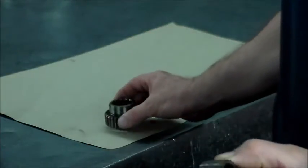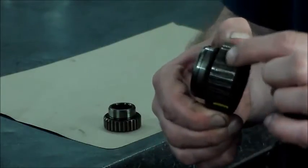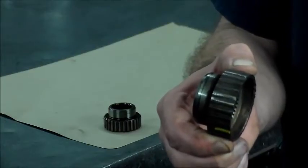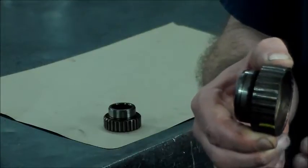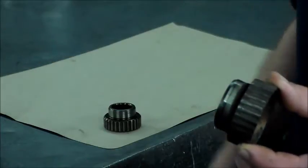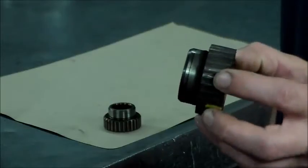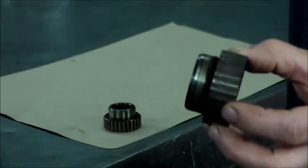So what I think happens with this, and this is, of course, only with the 4Matics, because the rear wheel drives, you're not going to have this. You see, this is really stripped out. There's nothing really left here at all. When we took this thing apart, it was really dry, with no lube or anything in there. And of course, the car was a 2005, so it took I guess about 11 years or so. I don't even remember the mileage on the car. I don't even know if it was up to 100,000. But it was very dry. You had all that red dust, so we had to clean all that stuff out.